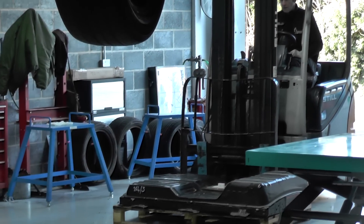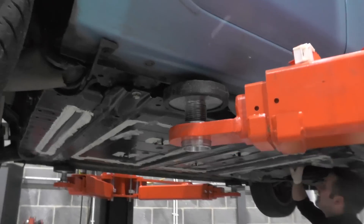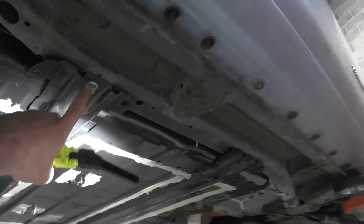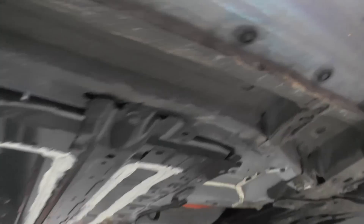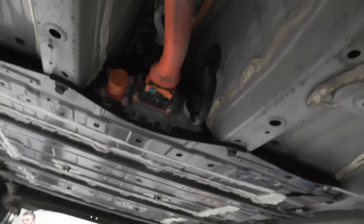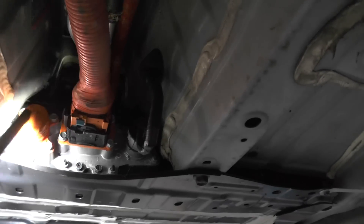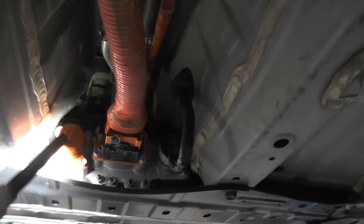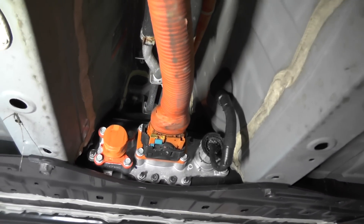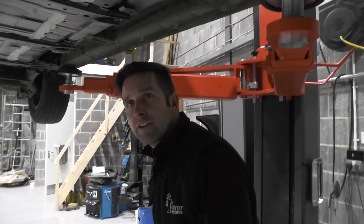Fortunately we had use of a forklift and Matt as the driver, which turned out to be very useful for shifting a 300 kilogram pack around. The pack is back in. We had a few problems getting some bolts out, but Keeper supplied new ones for that reason, so we've replaced some of them. The HV and LV connections are done and spliced in. The unused HV port has a rubber bung over it and HV tape around it just to warn people not to put their fingers in there. Under tray on and ready to go.